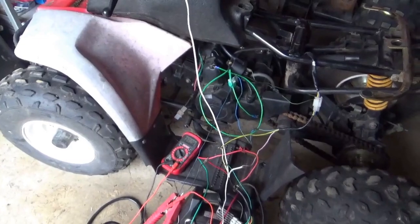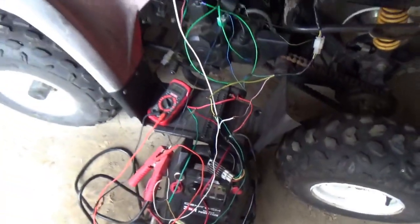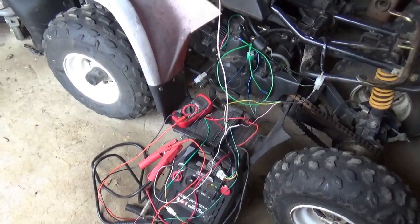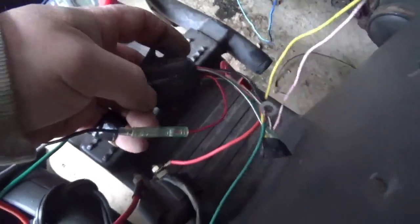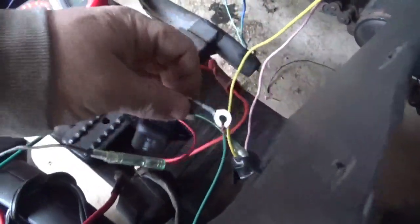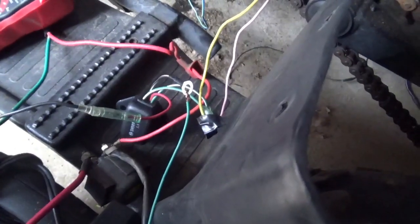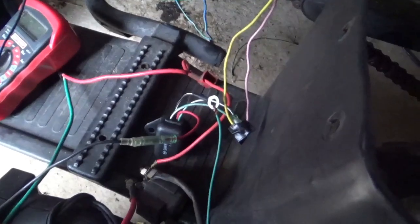This one is charging the battery. When you have a voltage regulator in, they put out enough power to self-energize — it powers up the CDI and runs. I got a deal on about 50 of these Yamaha voltage regulators, a whole box — I'll talk about those later. Anyway, I wired it in just to see if it would work: red hot, black with white stripe for ground, and two green wires with white stripes as the two AC inputs from the stator.